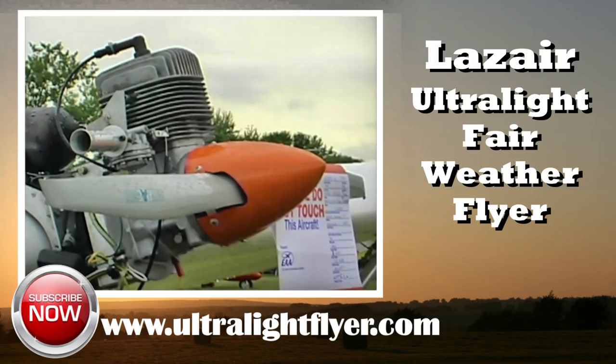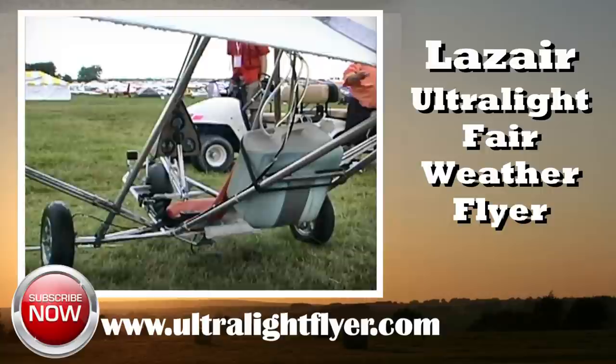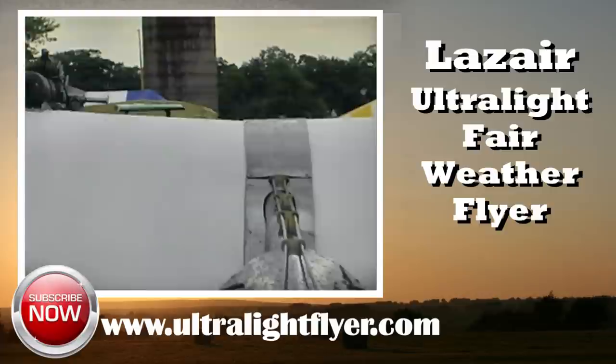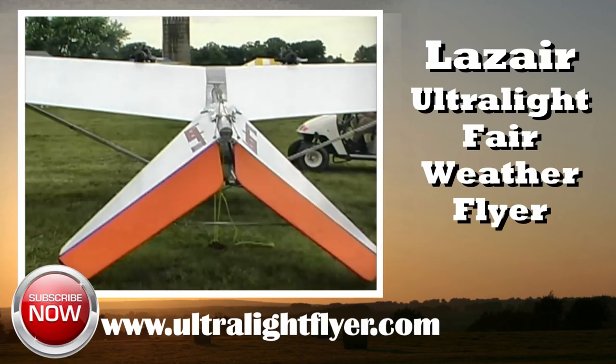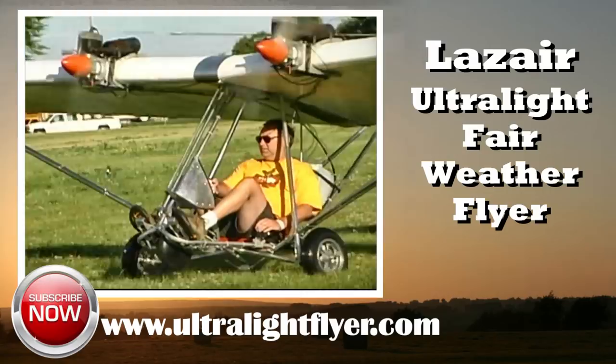The Lazair is available in several different series as a single-place ultralight, the last being the Series 3. Power was originally supplied by two modified Pioneer chainsaw engines of approximately 5.5 horsepower each. The Series 2 and 3 models use two single-cylinder, 9.5 horsepower Rotax engines. The engines are mounted on the leading edge of the wings. The Series 3 Lazair features a wider landing gear, a conventional center-mounted joystick, jury struts and toe brakes.